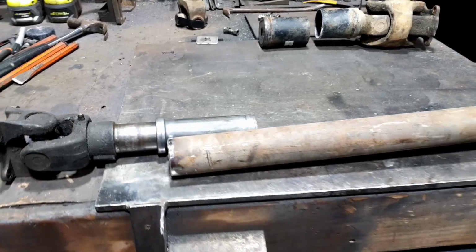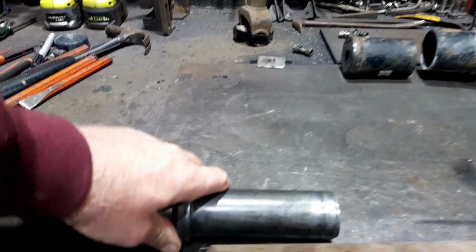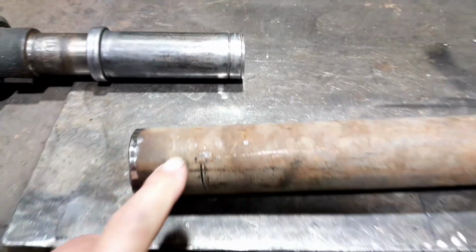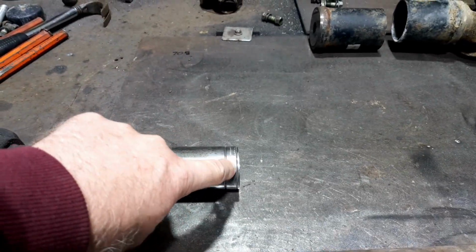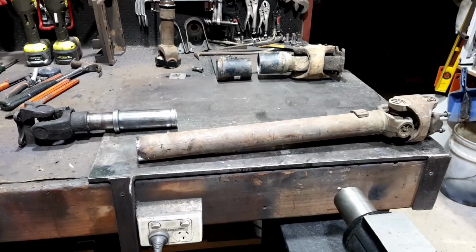Anyway, I'll go under the car and take the final measurement, do the old groove out with a grinder and put a heap of weld in there, so we've got a good surface, secure to connect to. Then I can cut this tube to length, drive it in and put a couple of plugs right where that edge is going to be, some sort of hope of it holding together. Anyway, then our drive shafts will be done. So let's get into them, eh?